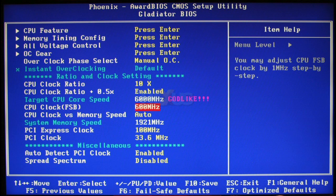There are also other things the BIOS can do — the boot sequence, plug and play (so if you don't want to install drivers you can enable that, though things will work at lower efficiency), mouse and keyboard settings, enable numlock, auto detect mouse, enable keyboard, enable USB ports, drive configuration so you can prevent things from booting from certain drives, memory settings to show how fast the memory is running and do a memory test (especially useful if you think you've got damaged RAM), security to set a password so nobody can mess with your BIOS, power management checks like sleep duration, and exit.